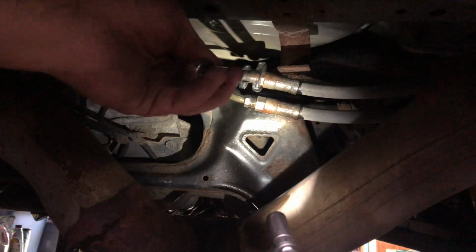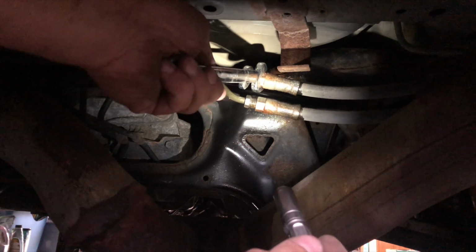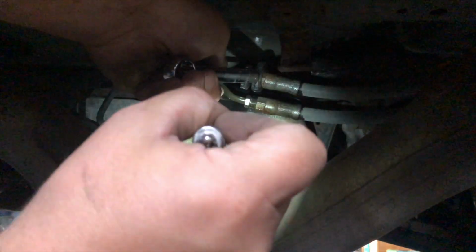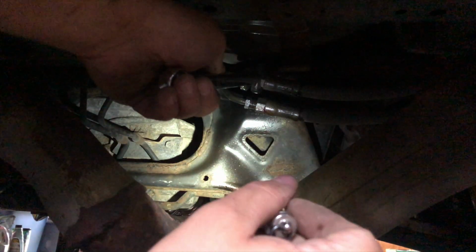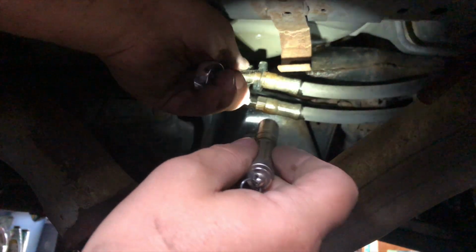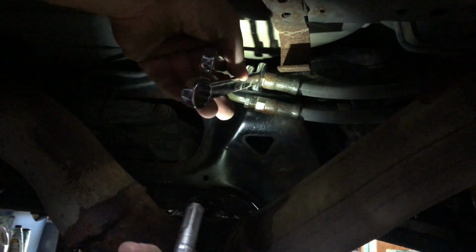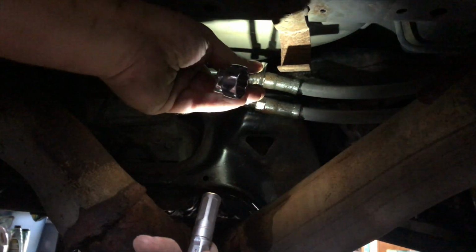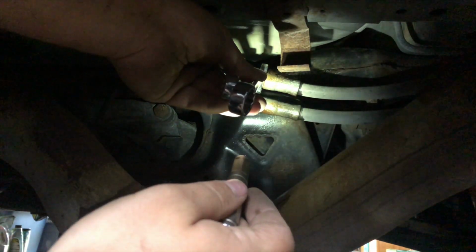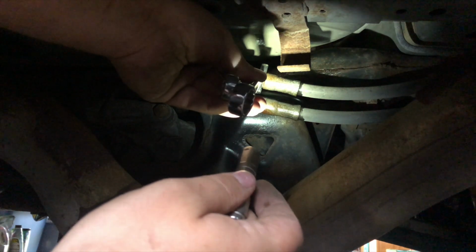Right, so you always wanna try to squeeze them together like that. If you end up trying to force them away from yourself, that's usually when a wrench goes flying or you end up busting your knuckles. So by having them kind of separated like that and then squeezing them together, that's always seemed to be the best practice in a lot of the shops that I've worked in.